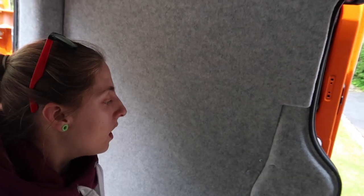Next up we had to do these panels. You can see here they're kind of carpet lined. Behind these panels we've got a layer of sound deadening and then the same reflective material that we have on the floor. We cut the ply, insulated and carpet lined them as well, and then bolted them on. From behind one of the panels you can see the insulation on both sides — on the panel and on the wall — which creates an air gap behind the ply panel to help with the insulation.